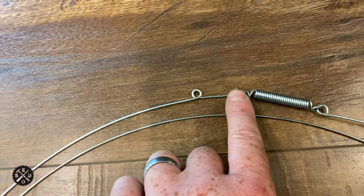Now we are ready to put the front on. Just make sure to line the three slots in the bottom with the three tabs sticking up. Sometimes these two middle screws don't line up perfectly — you can either push down on this part as you're putting the screw in, or pull up on the silver support to line them up and put them in. Down here in the bottom, put the one screw right in that hole. Next, pop in this plastic part, be sure to feed the rubber hose through this hole, then put those screws back in and clip the rubber back in. Before fastening the seal onto the front, make sure to clip this wire back into the safety latch so it can tell when the door's shut — you have to slide it straight up after the front is on because there isn't enough slack in the wire to do it before.